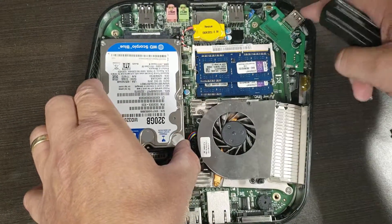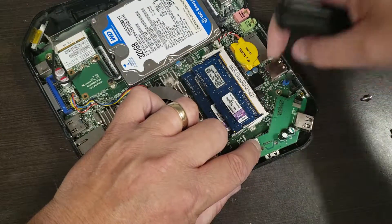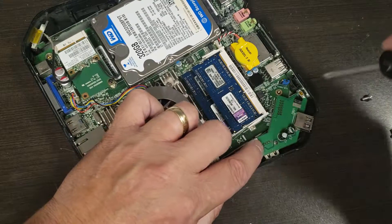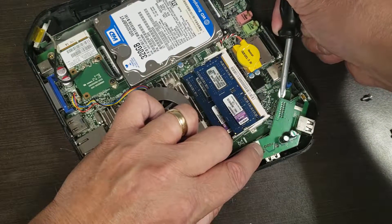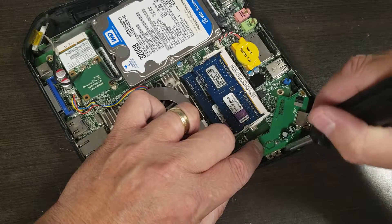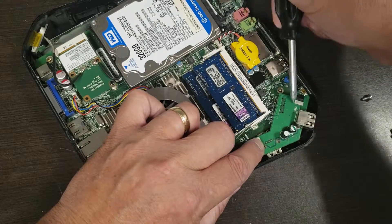The first thing you have to do is pull this little USB block off. There are two clips here — you just pry them back. There's a header under here so you just pry it up. Pop that clip back so it's not being held anymore, and this one here as well, and just pry this up. There we go. You don't have to be too gentle with it — the header is pretty solid, it's not flimsy.